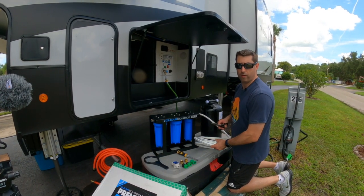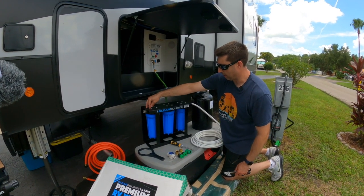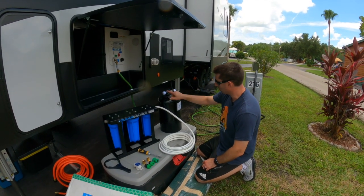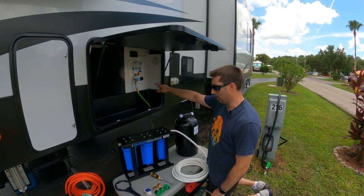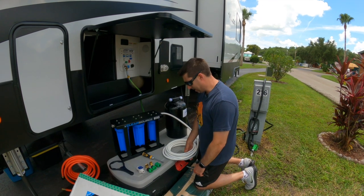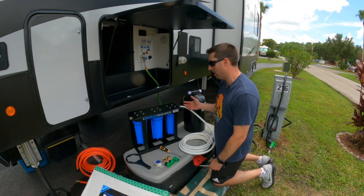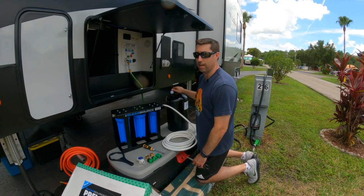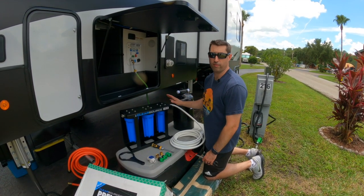I bought a small 25-foot hose. We're going to sacrifice lots of adapters to connect it because our water inlet from the faucet at the site will come in, run through the filtration system, through the outlet, into the water softener, out of the water softener, and then into our Nautilus panel. I decided to use a half-inch hose — we're only running about 40 to 50 psi, so a half-inch should be fine. Both the ClearSource and the water softener are rated over 100 psi, so we'll never push that much pressure through our RV, meaning the smaller diameter shouldn't restrict the flow.